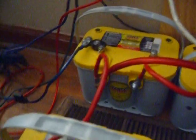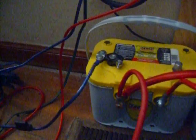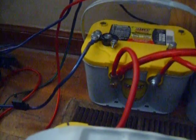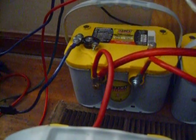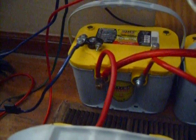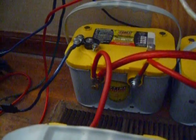So I'm not hooked up to that right now. I need to buy a 300-amp fuse. I just got it hooked to my battery right now — this is temporary. I don't think the inverter is going to go out anytime soon and blow up my batteries, but I am going to get a fuse link, a 300-amp inline fuse to put on that.